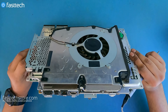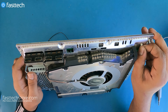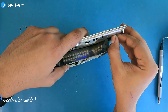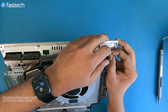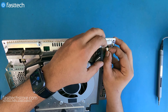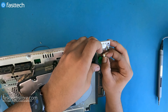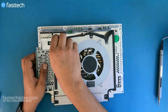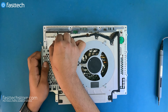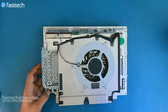I'm going to flip it over and remove the date and time battery — we're going to pull the connector and it's going to come off like that. Normally only the white piece is supposed to come off, but in this case the off-white connector came off too. We can put it back in — that should not be a problem. Now we're going to remove the connector for the fan, pulling it out. There are two more screws here that we have to remove.